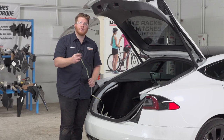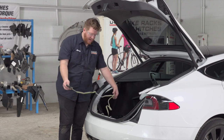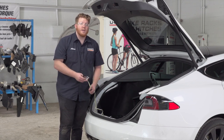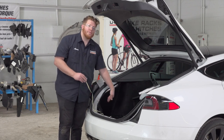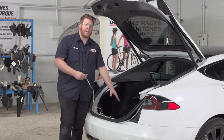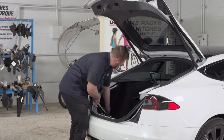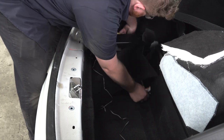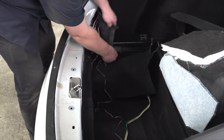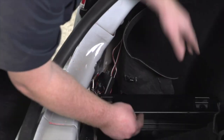Now in the trunk, let's go ahead and take a look at where you can store your four flat harness. You can leave it here in the cargo area and just pull it out through the weather seal when you need to tow, or you can bring it up underneath your vehicle right next to your receiver hitch and mount it there. If you want to do that, you can just bring your wiring down through that vent and pull it over right next to your receiver hitch. We're going to leave ours in our cargo area, so we're going to bring it underneath the carpet into the main trunk section and tuck all of our remaining wires behind our panels, then reinstall our cargo area.